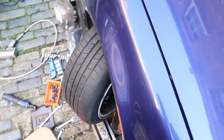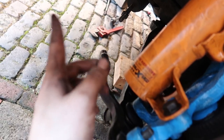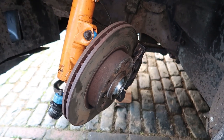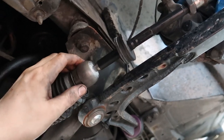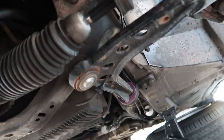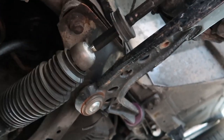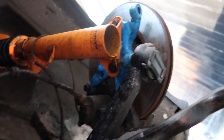I think this is definitely more angle than we had before. On this side I just need to change the tyre over and then this side's done, then bolt-check everything and it's done. Went a lot smoother than I thought. The other E90 tie rod is on - I find it easiest getting them on and off with one of these grip tools; it just grips onto it and is so easy. Trying to get a spanner to fit is a pain, so just use a pair of these - they work perfectly. Just need to bolt it up and then do a little eyeball alignment.